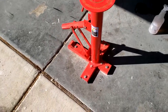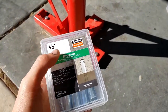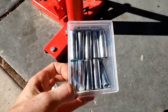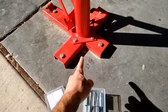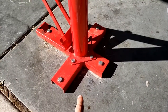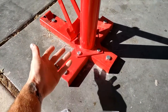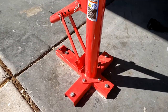So the first thing I did, I bought a box of these drop-in anchors. I bought the half-inch ones because you get a bit more stability, and I got the bolts for them. The reason I got a box is it was cheaper rather than getting a pack of four, and also if I put drop-in anchors here and also outside, I can move it to different places. With the half-inch anchors, you just have to make these holes a bit bigger so the bolts go through, because as it comes they're not quite big enough — but it's a good investment. It's absolutely solid, you can stand on that.